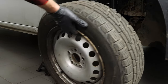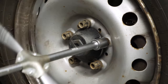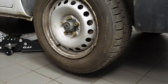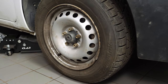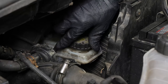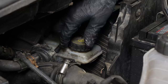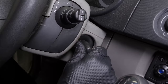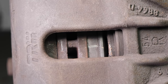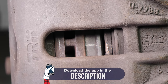Put the wheels of your vehicle back on and lower it to the ground. Before starting your car, don't forget to screw the brake fluid cap back in. Be careful! Before using your vehicle again, start your car and pump the brake pedal a few times to bring the brake pads together again. Try to drive smoothly and avoid sudden braking for the first 50km or so to avoid glazing the new pads.